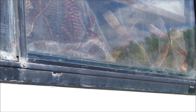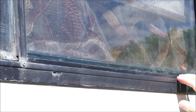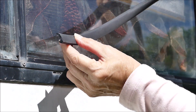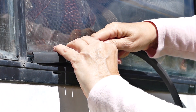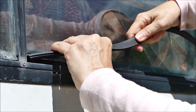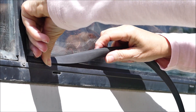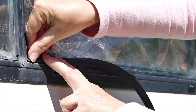I had way too many interruptions yesterday, so my glazing bead got cold and then I couldn't get it back on. It's easier to get on if you leave it sit out in the sun to warm up, and it's warmer today so I did that. Now I'm going to pop it back on. You can see there's a little channel here, and then under there there's a channel. That channel goes over here, and then this one clicks — there's a ledge under here so it clicks under there. This glazing bead comes in different sizes, so you want to make sure you get the right size if you order it.